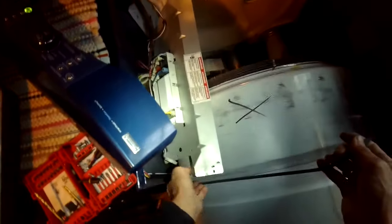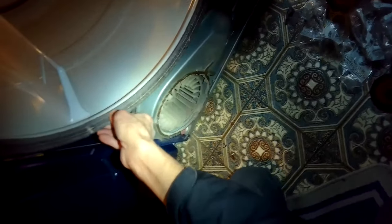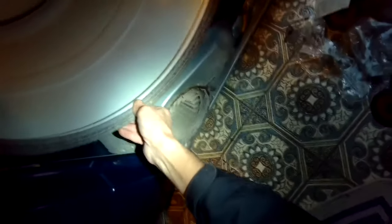We got them all done. We're going to bring the tumbler back in — holding it by the belt. I'm going to lift up a little bit on the control bracket and feed it in, get it all the way up against the back. Make sure the belt is right over the old mark where it was before. We're going to reach in on the right and left side, pull the idler wheel to the left, loop the belt underneath it, and then bring the belt over the smaller motor pulley. When we release tension, the spring tension will hold it really tight. We can see it's engaging because when we turn it, we see the blower wheel turning. We're going to do one full revolution to make sure the belt won't come off.